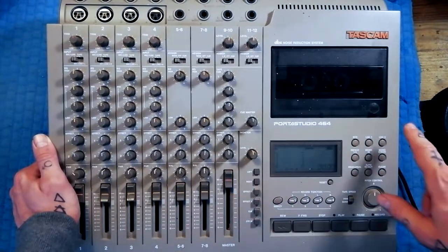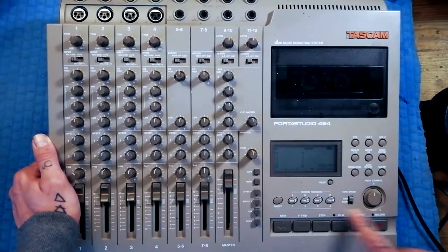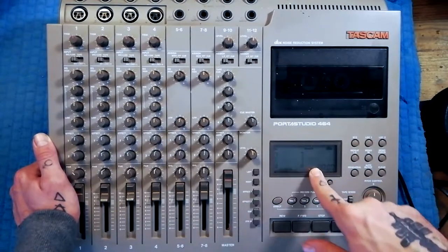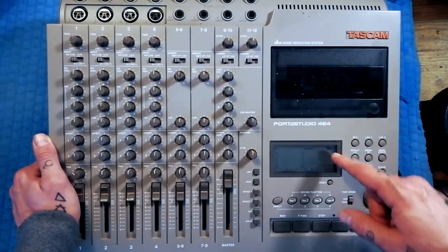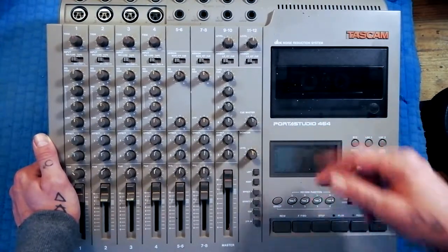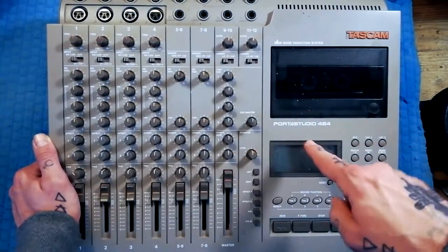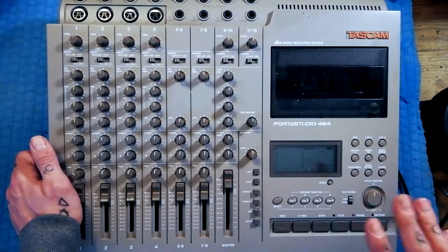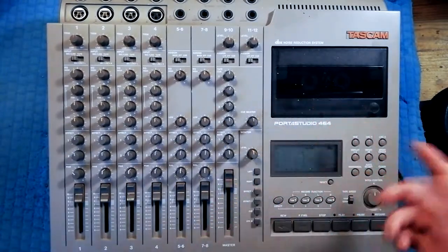The reason I'm telling you that is: usually when that gear crumbles, what happens is these buttons will flash — all three of them — and all the transport buttons will be completely unresponsive. I guess the logic circuit is going, 'hang on, the motor's turning but I'm not reaching the resistance value,' as that cog turns enough. Because that's not happening here, that suggests to me that the cog in there is still okay.